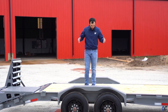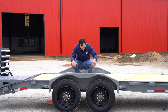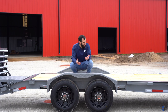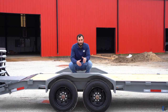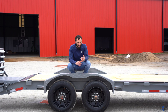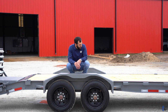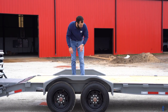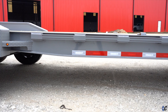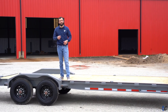This one is a 20,000-pound GVWR package — that's 2x10,000-pound axle torsions with 215/75R17.5 rubber. At 20k GVWR, this trailer gives you about 16,000 pounds worth of payload capacity. That's huge for heavier excavators or skid steers — great for a construction company or heavy-duty landscaping. When you choose the 20k GVWR package, it comes with an engineered I-beam, much like the FMAX series, where Diamond C has real control over the height, weight, and strength of the beam.